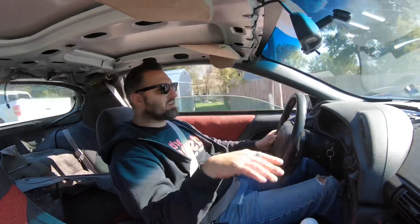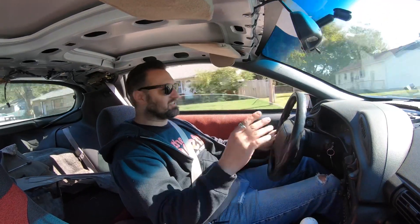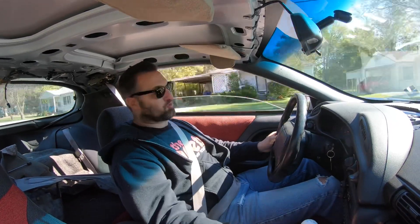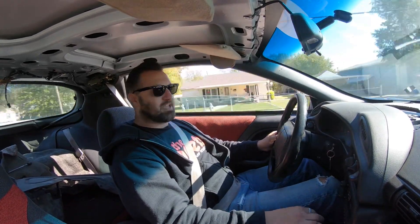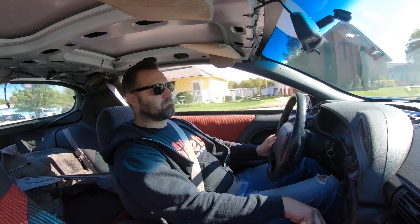I haven't flashed it yet — I just did idle stuff in my driveway, revving it to make sure it wasn't gonna backfire, and got that squared away. Here's my perspective: this car is just balls — it runs really good. I haven't even really gotten on it but you can just tell it wants to go. The fuel trims look really good — they're a little rich, about 7%, 10% in some areas, nothing crazy. Everything's working really good. This is gonna be a really good tune.